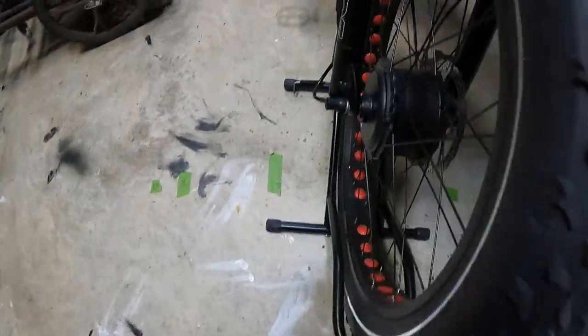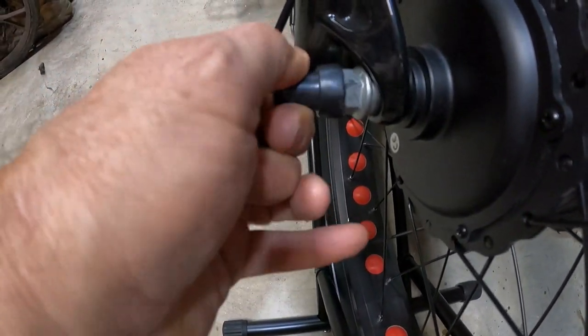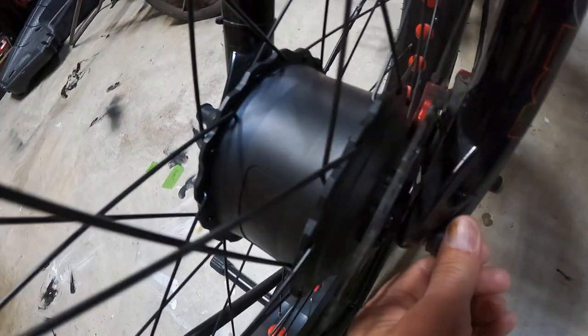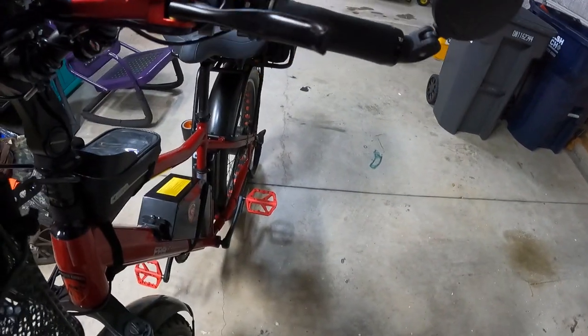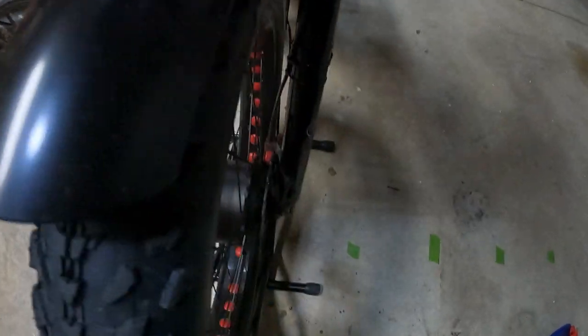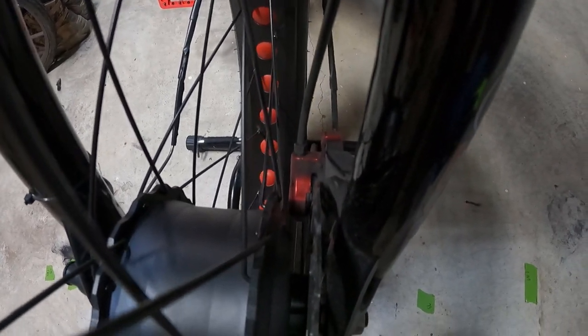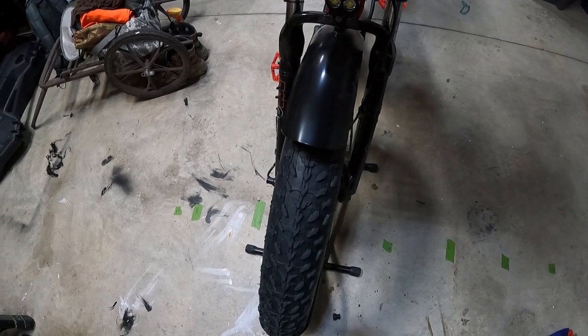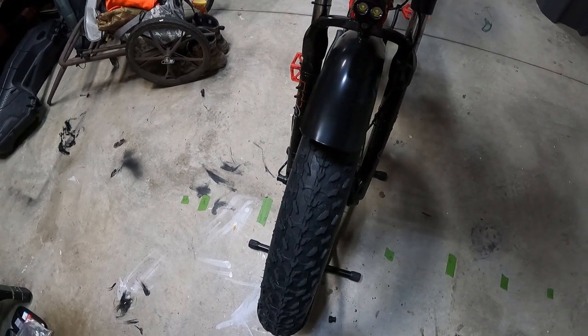This is how I fixed it: I re-centered the particular wheel — for me it was my front wheel. I took off the connections and loosened up each bolt. This one has bolts because there's a motor. When it was loose, I grabbed the brake caliper and held it, then tightened each bolt alternately until both were tight. When I looked down through the brake caliper I could see daylight, so I knew the wheel was perfectly centered and the sound was gone.